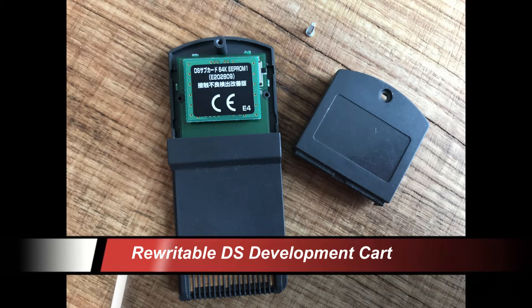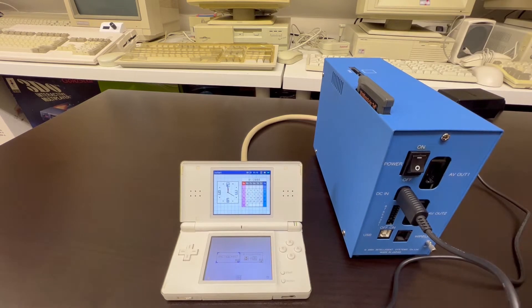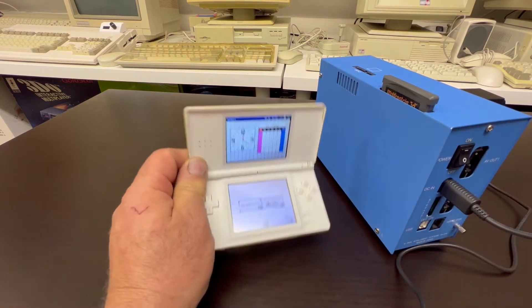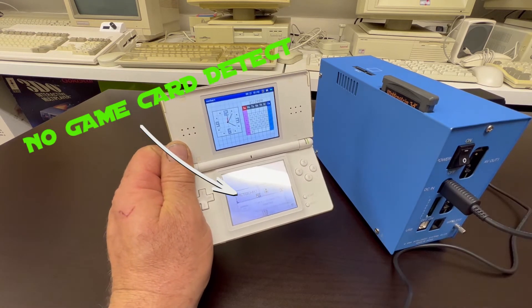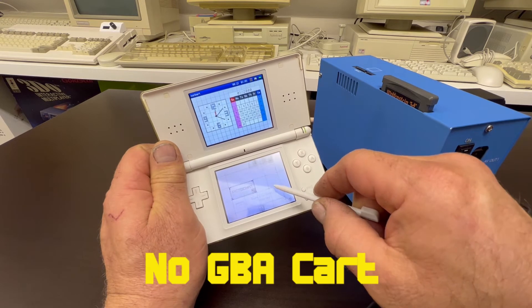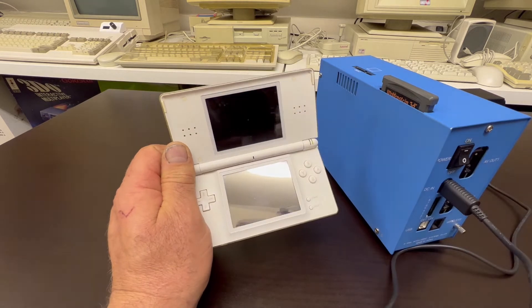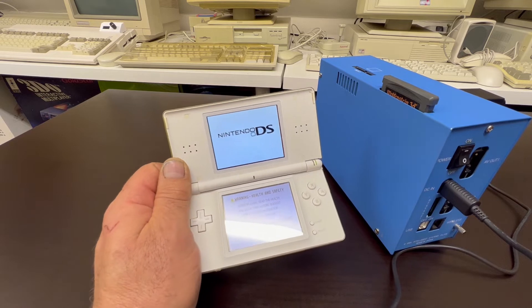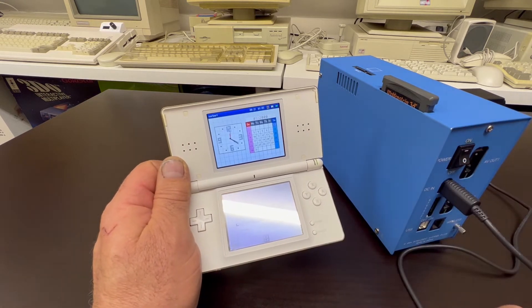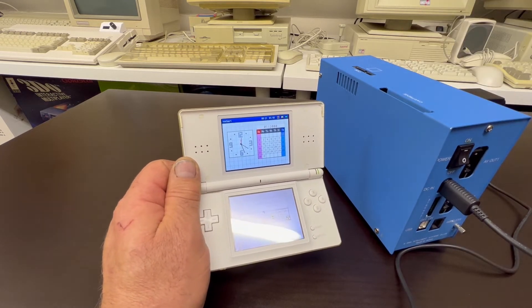This is a test cartridge — you could write to this test cartridge and then put it into the IS Nitro emulator and play it. To give a demo: this is the unit out of its box with no firmware modifications, exactly as purchased. As you can see when you put the DS cart in, there's no state change — the machine doesn't recognize it. That's because the firmware it came from the factory with didn't support anything: no video out, no cartridge slots. It was purely for injecting code in from a host PC to test on the DS handheld unit.